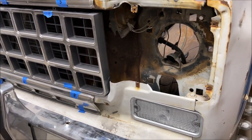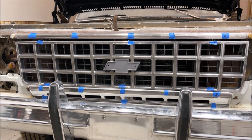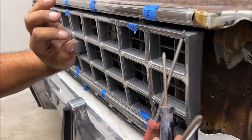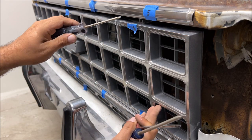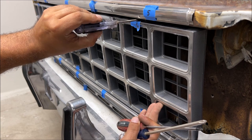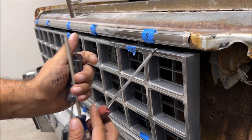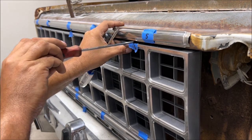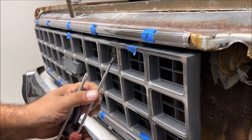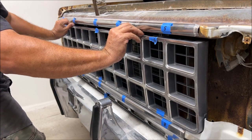We're just showing the difficult stuff — anybody can figure out how to take that out. To get your two headlight buckets off, the grill comes out next. You have six screws on it. I have never seen original grill screws in my life — I have no idea if they're Phillips or T15. If they're T15, great — that's what we're going to put back in. If somebody has put Phillips in there, avoid using a standard number two Phillips and use the smaller one. This grill only had one screw in it. The grill comes out from the top first, so you kind of want to push down and get it out.